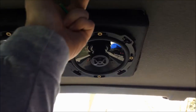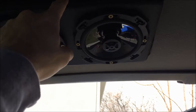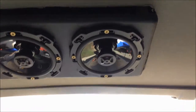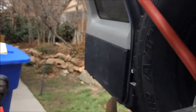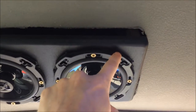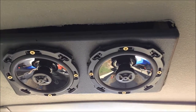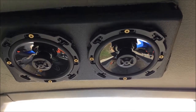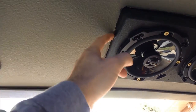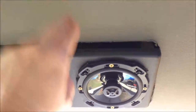I'll probably rebuild a new plate where it has a plate behind here and one up front that sandwiches it. Probably take the front one and either make it thinner - this is about half-inch ply - or recess them inside so the actual speaker rings themselves sit recessed inside the outside plate. You can tell with the foam, I definitely used the foam buckets again. I think I'm going to change that, much like I did the two doors up front where I staple those inside the ring instead of on the face of it. The speakers just sit more flush and look a little cleaner.